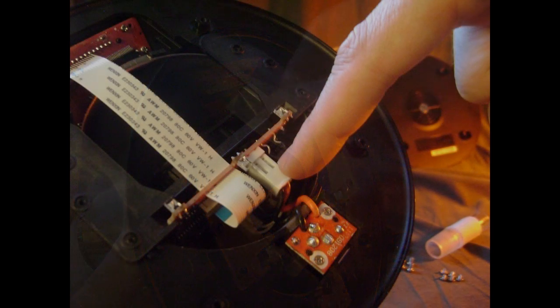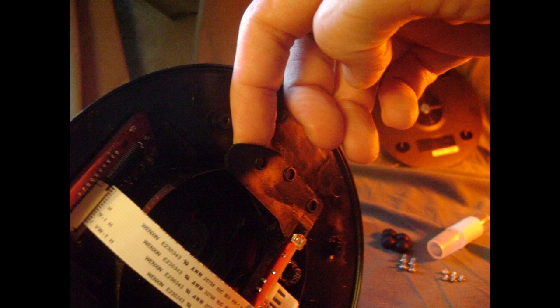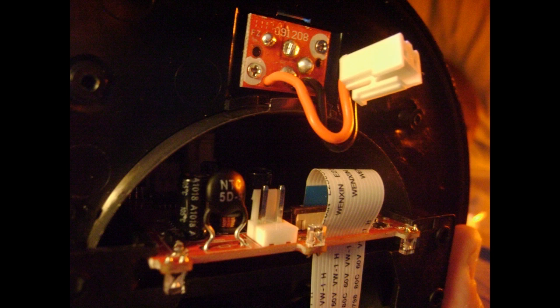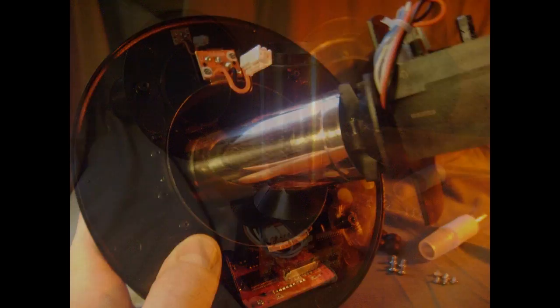Next, you unplug the wire that connects the power input of the machine to the main circuit board. But it too is locked into place. Now, you have to press in the locking tab on the underside of the plug. It'll likely be difficult to get your finger under the plug to do so. Simply loosen the center mold from the base, and even though it might seem stuck or a bit tight inside the unit, carefully pull up just a little bit to lift the center mold out, so that you have a bit more space to slide your finger underneath to press in the locking tab and pull off the locking plug wire. Once it's disconnected, pull the center mold, which contains the glass heater cover, straight up and out.